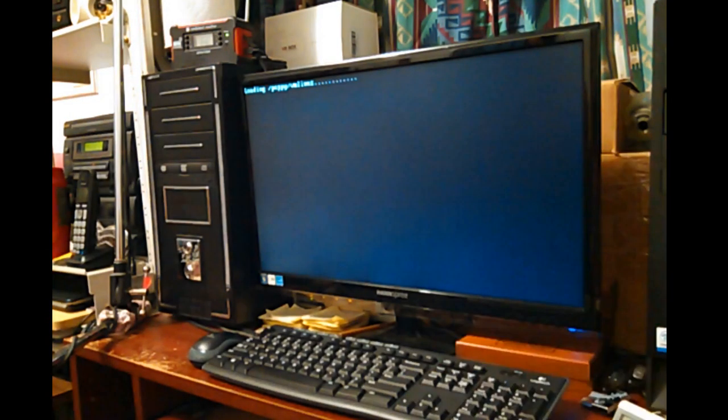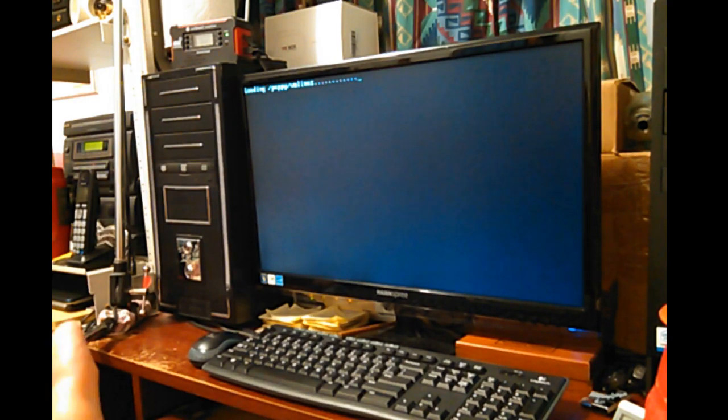I can't remember the problem exactly, because I don't really try putting bigger hard drives in older things like that. But in a Pentium 4, I know they read 80 gig hard drives, because that's what I had in the first one I built. I put an 80 gig hard drive and Windows XP in it, and the only trouble was XP's limitations, not the BIOS. If you put Linux on them, they just boot, because I think GRUB boot manager takes over, and you have no problems with it recognizing the full hard drive, no matter how big it is.